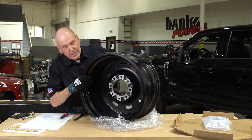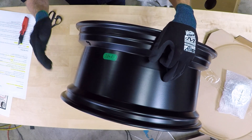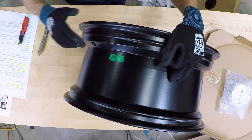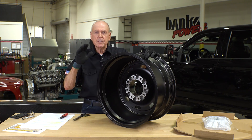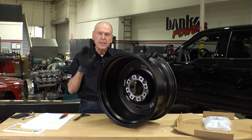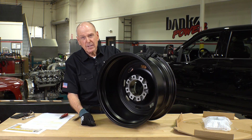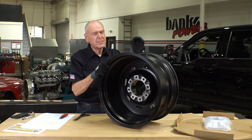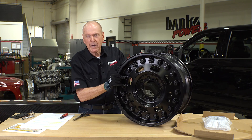I like going to bigger brakes when you go to bigger diameter tires. Why? There's a ratio of the brake rotor diameter to the tire diameter. When you go to a bigger diameter tire, the mechanical advantage of the brake rotor diminishes. In other words, bigger tires means less brake performance. That gives you jeopardy probably only when you get the stock brakes hot enough.